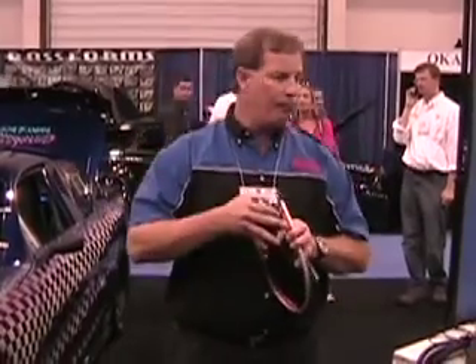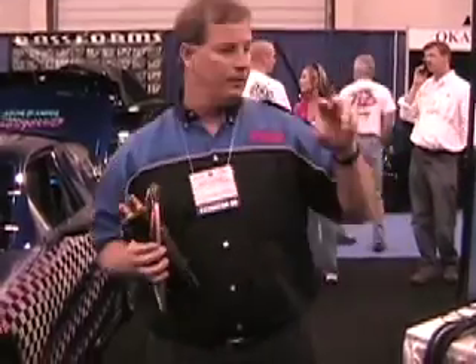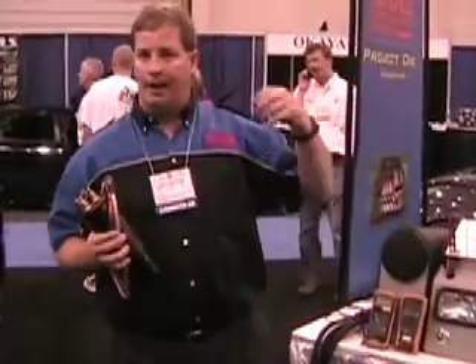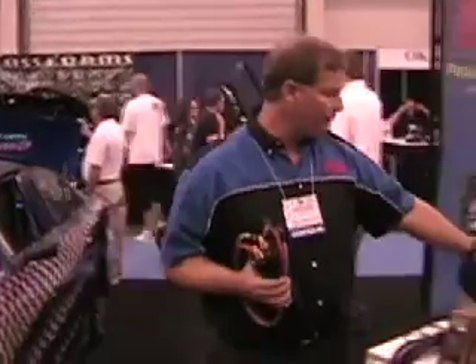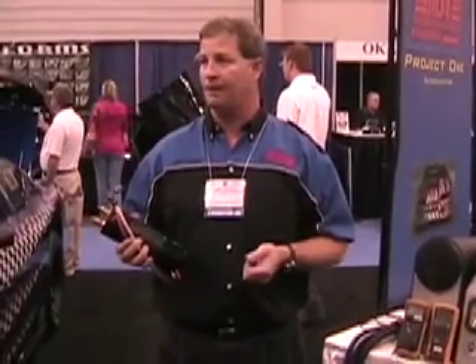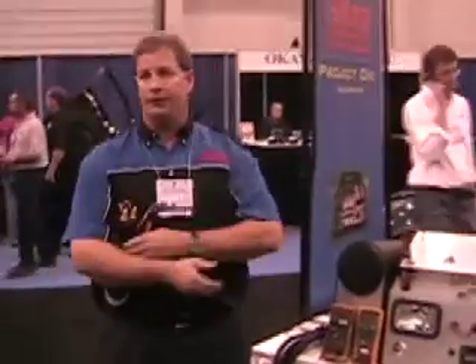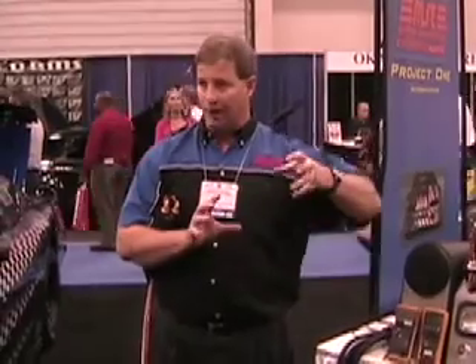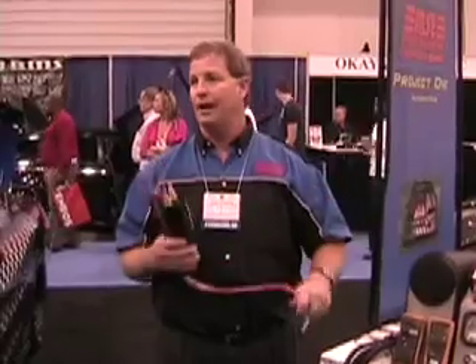Caps are designed to help with stabilizing the input power supply on the amplifier. If you've got your meter on the input of the amplifier and the amplifier is shutting off when you get big bass notes, check the voltage at the input. If it drops below the minimum voltage for that amplifier and it's shutting off, the cap may help - maybe - if you're listening to music that has real quick transients like kick drum. But if you're using test tones or music with test tones mixed in, those are really hard for long-term stuff, and the overall voltage is just going to drop because the cap's not going to help you.